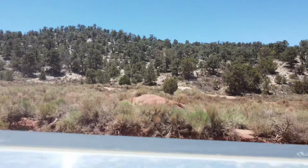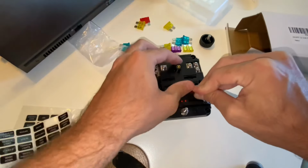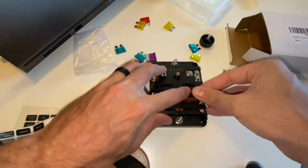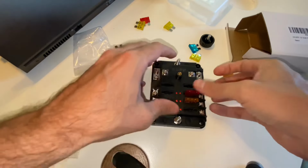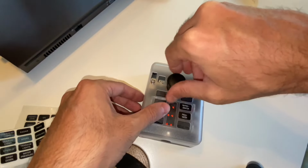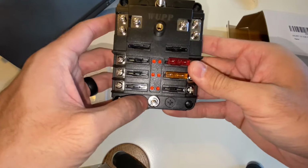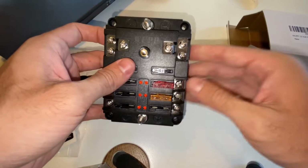It takes DC power. To start out, let's assemble our DC fuse block. You can get this thing on Amazon, no problem. I'll link it in the description. I'm going to use a 5 and a 10 amp fuse, one fuse for the water pump and one fuse for the refrigerator, which I'm switching to DC power for efficiency reasons.